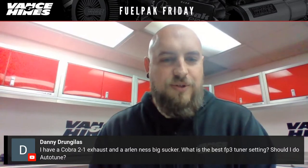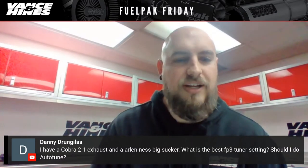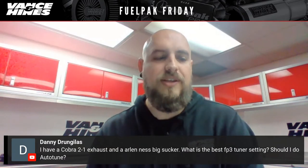Danny on YouTube says, I got a Cobra 2-to-1 exhaust and an Arlen Ness big sucker. What's the best FP3 tuning setting? Should I do auto-tune for the Cobra 2-to-1 exhaust, depending on whether it is a short or a long exhaust? Two things. One, you can go to our generic map section if you're not sure. We do have generic maps for a 2-to-1 long and 2-to-1 short in that area. So if you go under manufacturer, check generic, go find those 2-to-1s.